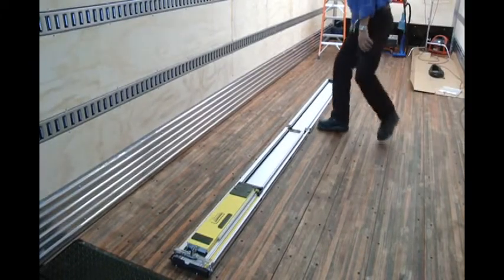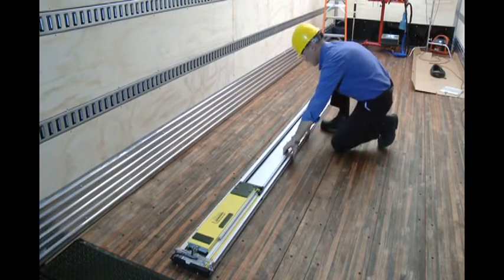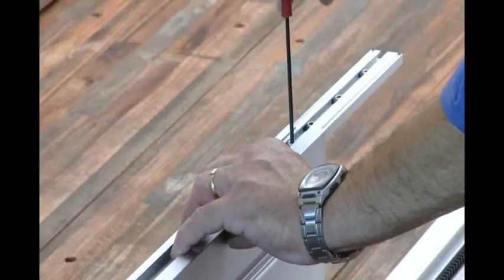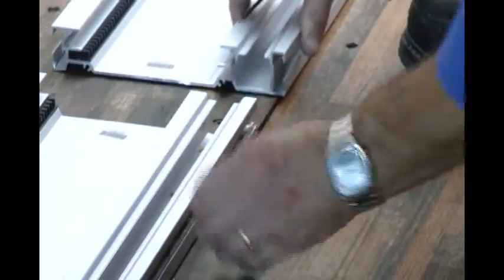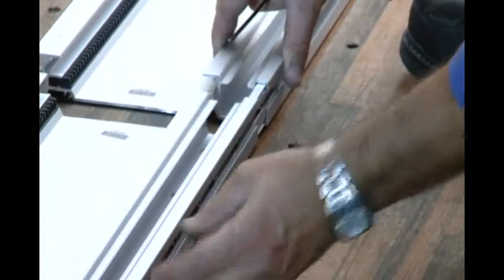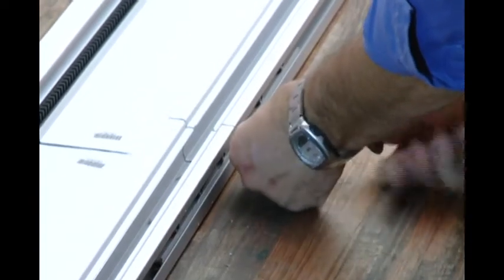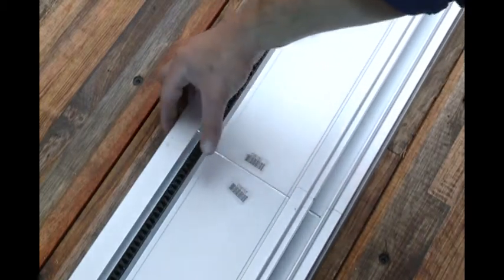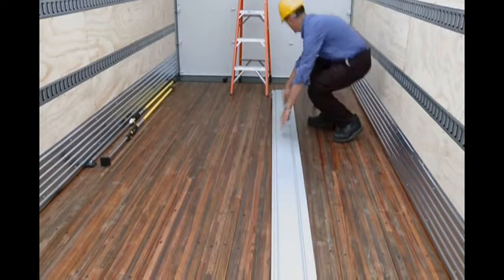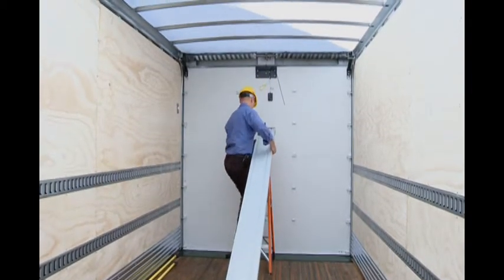The next step is to assemble and install the Command Lift aluminum track to the roof bows of the trailer or truck body. Line up the two pieces of track on a straight, level bench or work surface. Using an Allen key, loosen the six screws on each side holding the joiner slides in the rear track section. Pull the two track joiners halfway out of the rear track section and lightly tighten the two front screws. Slide the front track over the two joiner pieces and ensure the two tracks fit together snugly. Make sure the tracks align properly and there are no sharp edges at the joint, as sharp edges will cause premature wear to the motor sliders. Tighten down all screws and check for fit and alignment. Pick up the front of the Command Lift track assembly and fasten the adjustable mounting bracket to the balancer center bracket installed earlier.